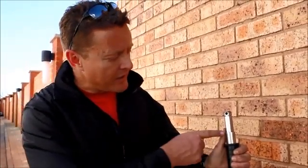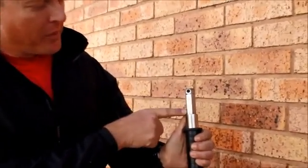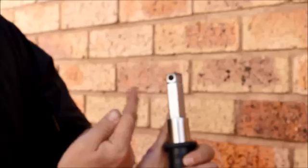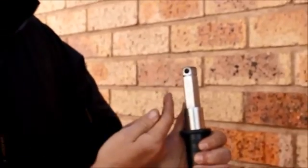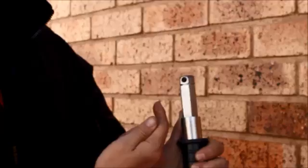How to set your heavy-duty torque wrench is by adjusting the adjuster knob at the back of the torque wrench, using a screwdriver and setting it in or out according to the specifications of the vehicle manufacturer.